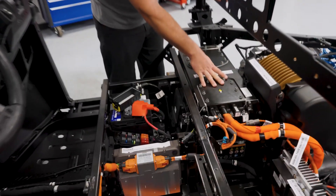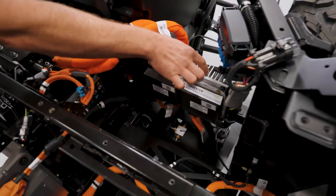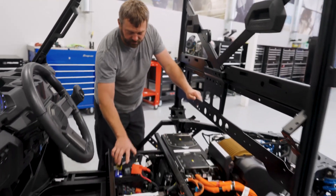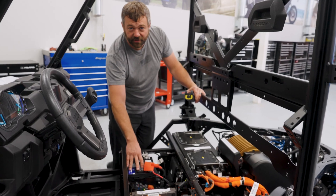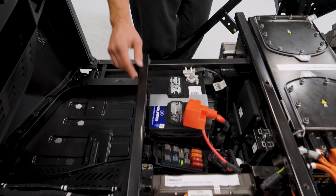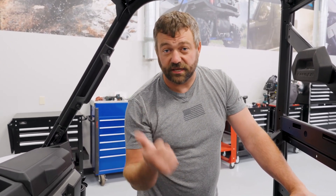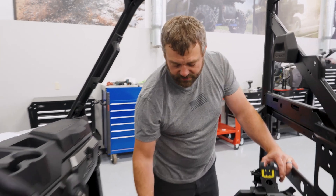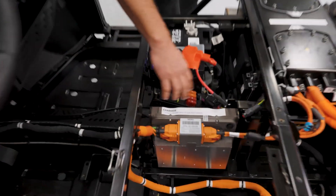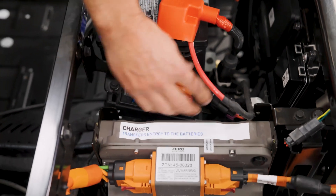From here we've got power coming out at 100 volts. You can see a couple of black boxes labeled DC-to-DC converter with a giant fin heat sink on the back. What those do is take the 100 volts off the battery pack and drop it down to a normal 12 volts, actually charging this 12-volt battery underneath the passenger's left thigh under the seat. This 12-volt battery is similar to what you'd see in a gas Ranger — it provides power to standard loads like tail lights, headlights, gauges, power steering, and the 12-volt outlet in the back box. All the 12-volt protection — standard relays, fuses, and bigger ones for the DC-to-DC converters — is here underneath the seat.